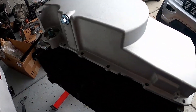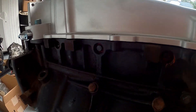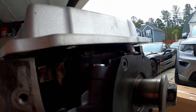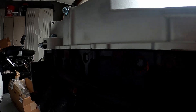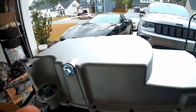So I ran into a little bit of a problem. As I was installing the oil pan, I noticed it wasn't seating correctly. You guys can see the gap there. The rocking is indicative of something not clearing, so I took the pan off.